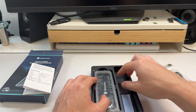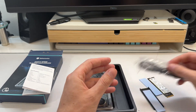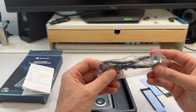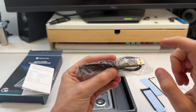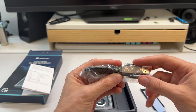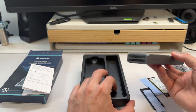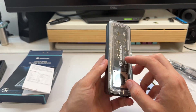Typically I find this stuff easy to set up. Inside we have some thermal pads, the SSD, some little connectors, and a USB-C to C slash A cable. So if you don't have a USB-C connector you can go with A, though USB-A won't run as fast because your computer port itself won't support the full speed. It's a nice metal chassis, so that alone will get some of the heat off.